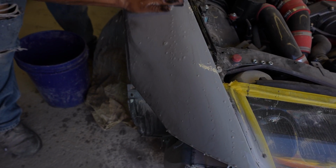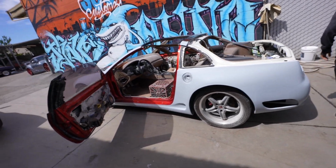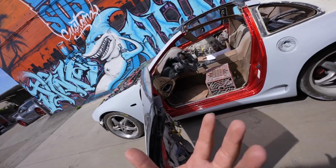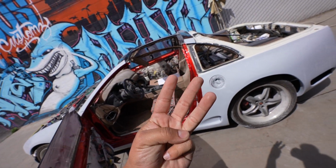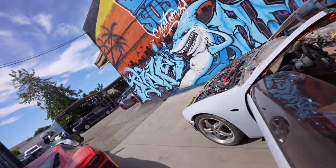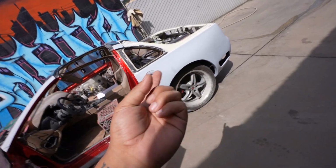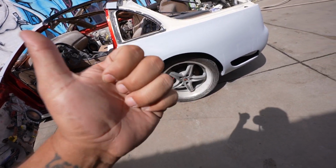Alright guys, here she is. We already jammed the car. We've already primed it 3 times, right? First time when we did all the body work, we reblocked it, reprimed it. Right now we are jamming the hood. We are painting the T-tops. And next up is we are gonna undercoat the quarter panels to make this look all nice.